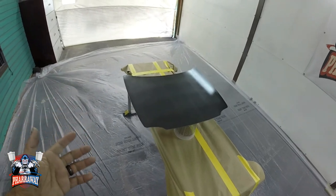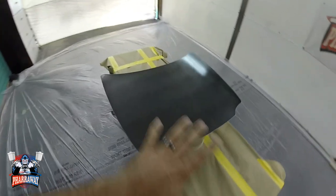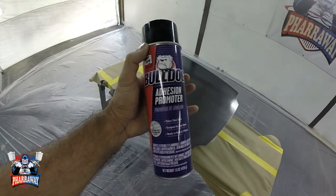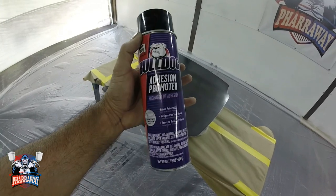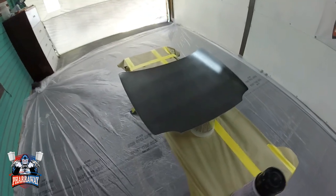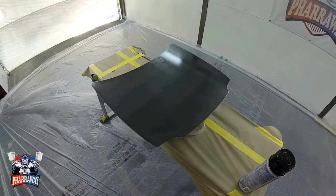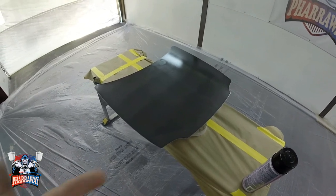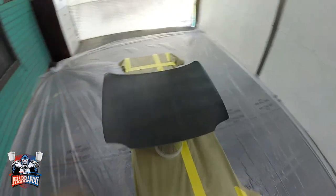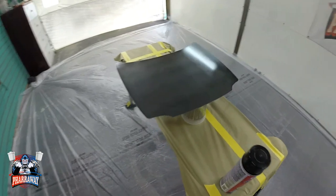I'm going to leave in the description below all the materials I'm using, so if you want to practice yourself go right ahead. This is a blank sheet of metal. All I did was sand it down with 80 grit, got myself some Bulldog adhesion promoter, just applied two coats — that's it. This is just going to be for decorations, I don't need to put any direct metal primer or self-etching primer. This is just for decorations, it's not going to be out in the weather, so that's perfect.